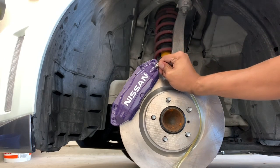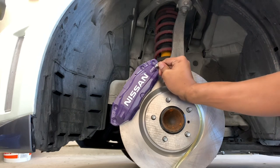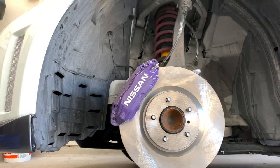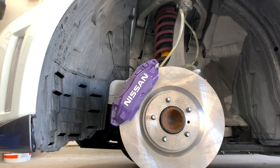I tried moving the car back and forth and noticed the pedal was feeling very soft. Luckily my wife showed up after I was done and she helped me bleed the brakes — pressing the brakes while I opened and closed the valves. It was very helpful because I didn't have someone there to help me before. Brakes feel great now.